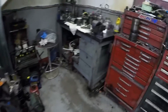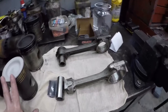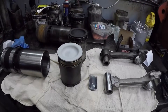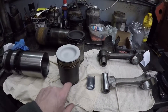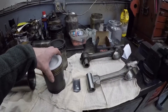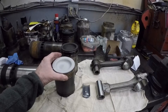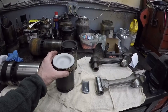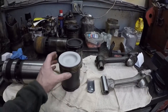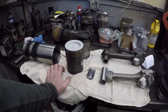The pistons here — a comparison between the new Silver Series here and the older trunk series over here. It's a two-piece piston with a seal in between, and it allows the skirt to be slightly independent of the crown. So two different forces acting on the piston. There's a little bit of flex in this that helps longevity of the piston and liner.